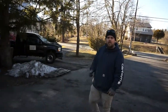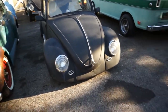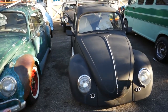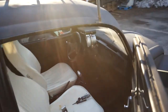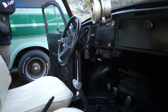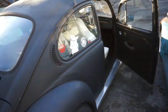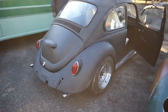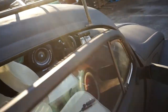What's up guys, Keith here, Two Guys How-To, June's right there. Today we're going to show you how to change the key switch in a Volkswagen Bug. This particular one is one of the lowriders we're working on and it's having trouble starting. We traced it back — we're not getting any connection from the battery to the starter motor. The key's turning over but the vehicle is not starting. This is a '71 or '72 standard beetle, not a super beetle.